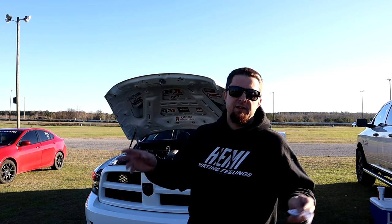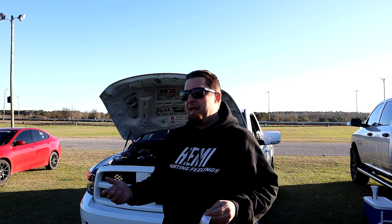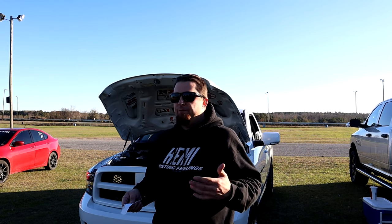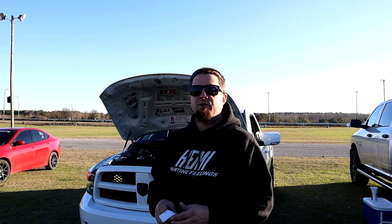I went out there, tried a second pass, and blew the tires up immediately, so I just rolled the rest of the track. Didn't even get a time slip for that because it was worthless. Came right back around, basically just re-hot lapped it, got right back in line, and figured I'd try it without trans brake launching and just foot brake launch it. Figured it would probably hook then, even though the track was so bad you could hardly hear the glue on the ground anymore. So I tried that and it still blew the tires up immediately as soon as the power came in.